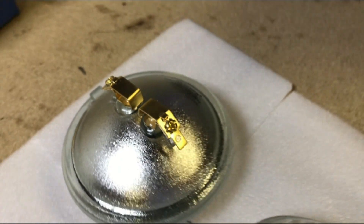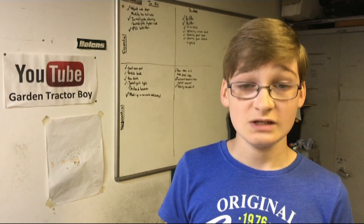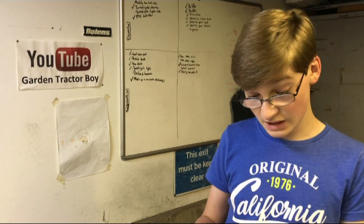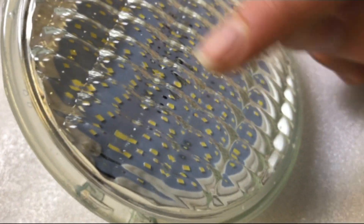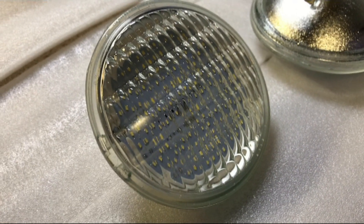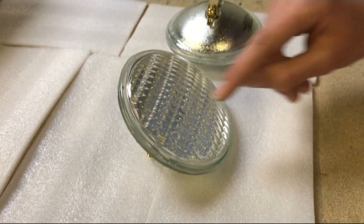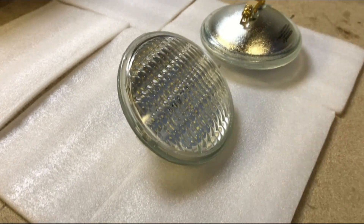The specification to match the originals is nine watt LEDs - they need less power from the battery than halogen lights do. You'd want them in cool white, which is 6000K, and that is the colour produced by the LEDs, which is the colour you saw from the HT20. Finally, you'd want the ones that have 51 LED chips in - the chips are these little yellow dots here, which are the actual light sources. That doesn't make the aesthetic look any worse, whereas you can get 18 chip ones where the chips are quite big circles, 18 of them. Those do stand out quite a lot and look quite different to the originals.